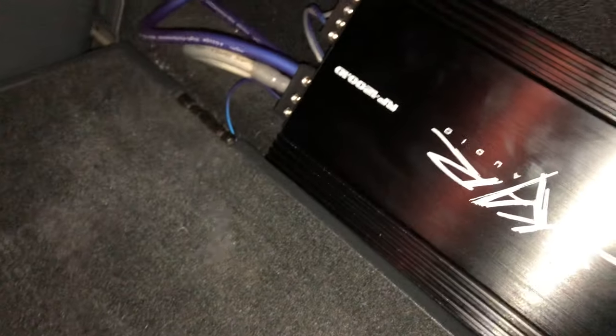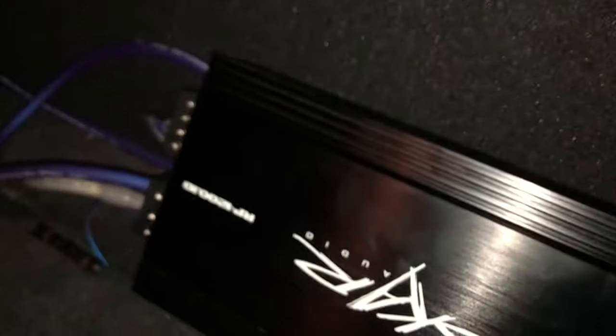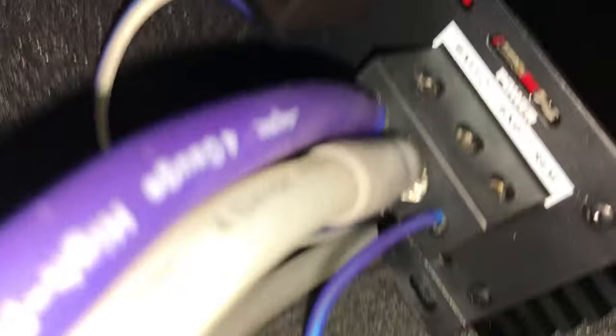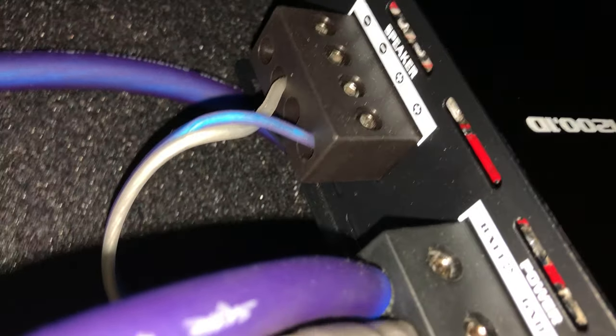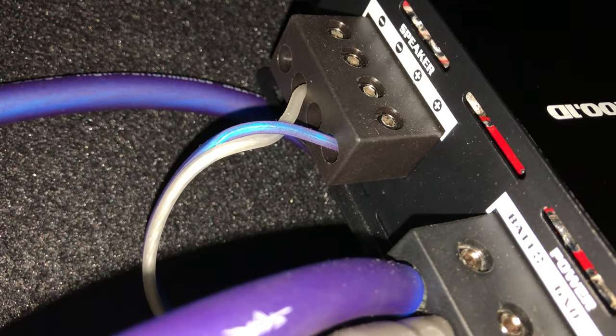Now that you've done your power and your ground wire, it's time to move on to the stuff you're going to put in your radio. This is the fun part, because you can't have a sub sound system without a new radio. They make dash kits — I'll provide a link to the website I use in the description. They have dash kits, radios, adapters, everything for your vehicle. Moving on — we have our REM wire. When you put these in, remember: strip tons of wire, make a ball, and stuff it in there so you have a really good connection.